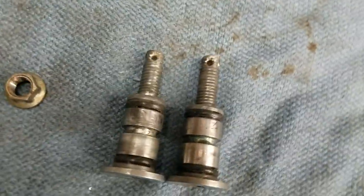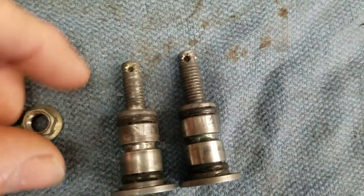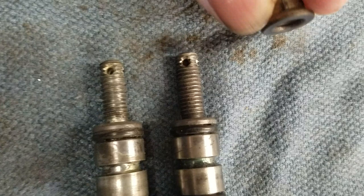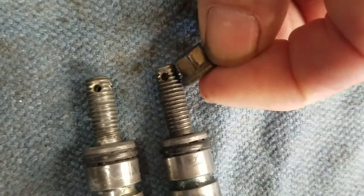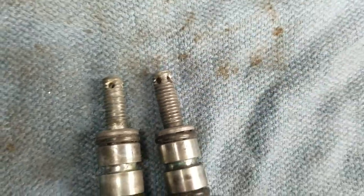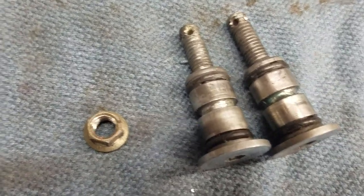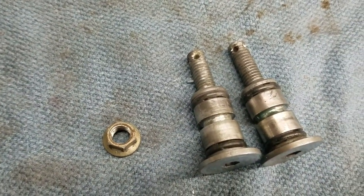The swing arm is close, so we want it tight and tucked away — plus then you won't see it. If you put a big 12 millimeter nut, you're probably going to see it and it'll look kind of ugly. Now, once you use this nut, you're not going to be able to put the little clip in here anymore. The nut will be fully threaded down but it blocks the clip holes. So you're definitely going to want to use some Loctite. I prefer red Loctite myself — it guarantees a grip. Let me go ahead and show you the part numbers for these two things.